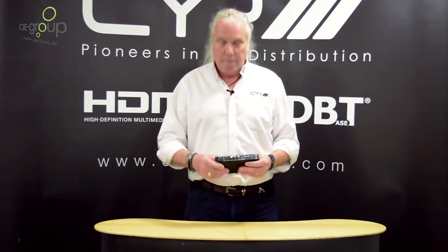There are practical applications. Imagine you have a multi-room scenario where one of the rooms is a home cinema room that requires multi-channel audio, and you have a centralized source. The problem is you may come across some TVs that are not capable of down mixing these multi-channel audio codecs. By installing this next to the TV with an HDMI input from the source or from the matrix, you can set the HDMI output to two channel, which means the TV will always give you two channel audio.